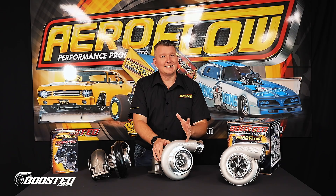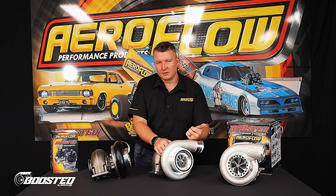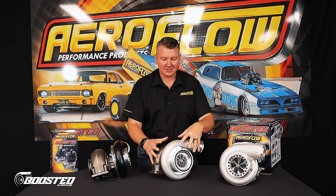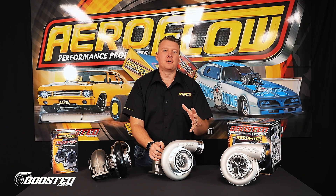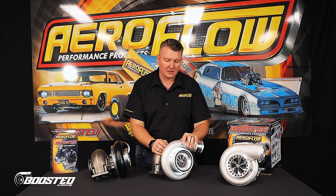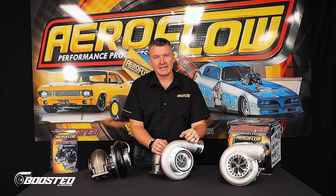The vehicle was much more responsive. It had previously run a larger turbo — similar to our big boys, a 103 turbine combination — which made slightly more horsepower, but it was very lazy. Being a manual street car, there was nothing happening in first or second gear; it started to go in third, and in fourth you'd probably be going to jail. Sometimes you've got to look at what's appropriate for your application, even if the turbo seems very big. And that was a ball-bearing 88-88.